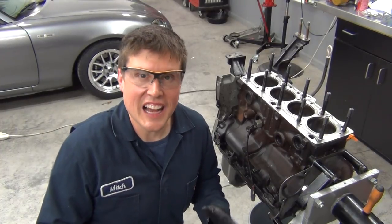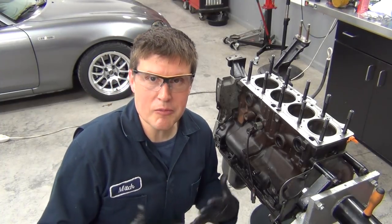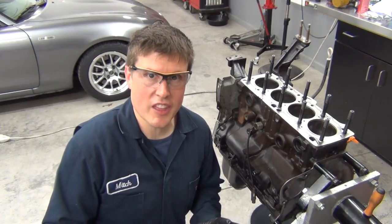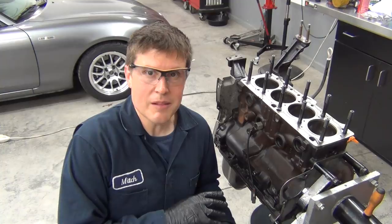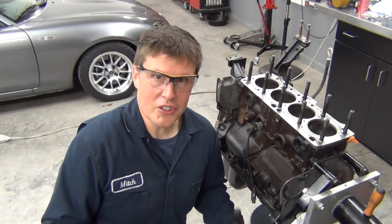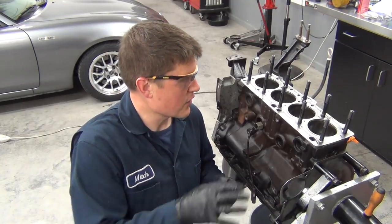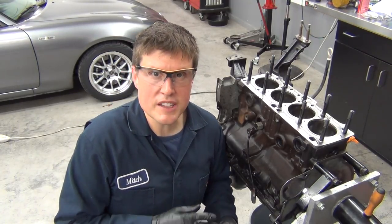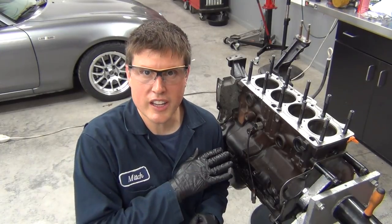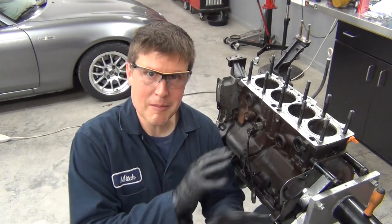I'm just going to go ahead and apologize in advance. I know I'm not doing much videoing right now and I'm jumping ahead, but the truth is when I get in a situation like this where I really have to concentrate, I'm just not good at documenting that process. It was the same with the V8 Miata build when I did the wiring. If you've ever tried to video yourself working in the garage, I'm sure you would understand. So where we're at right now is I've cleaned off the block surface — the deck surface — and I've checked to make sure it's completely flat. If you want to see all that in great detail, I highly recommend you check out Jaffro Mobile's channel. He's done a superb job of documenting all that with specific how-to information and measurements, and he's just a genius in that regard.